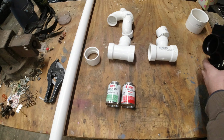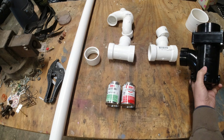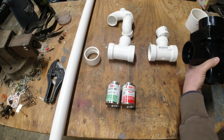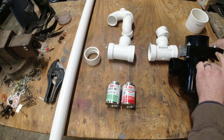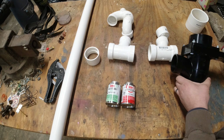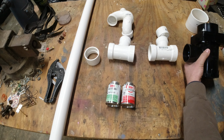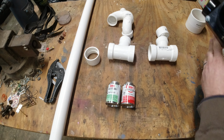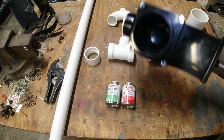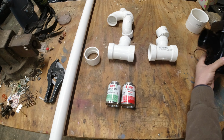And then I have the actual sewer drain right here, the waste valve. I got this one from eTrailer, and I'll put a link in the description below. But I'm going to take these screws off, and you can rotate this gate valve around, because mine fits in the camper like this, but the valve's got to be this front way. So it's just an open and close valve like that, and it'll join up.